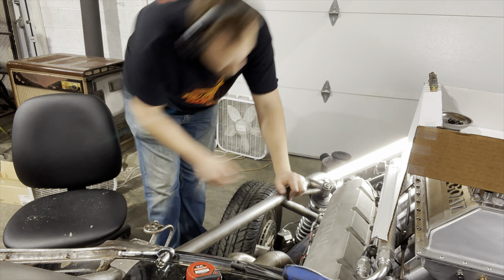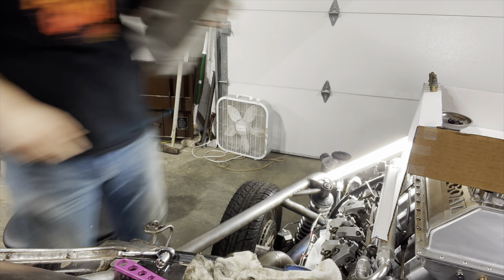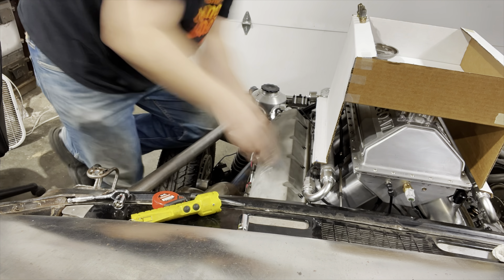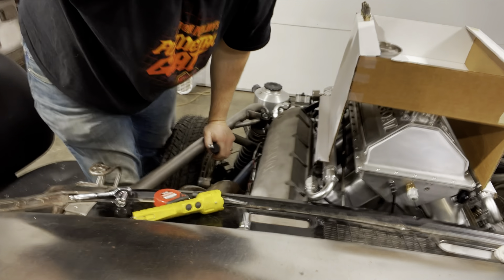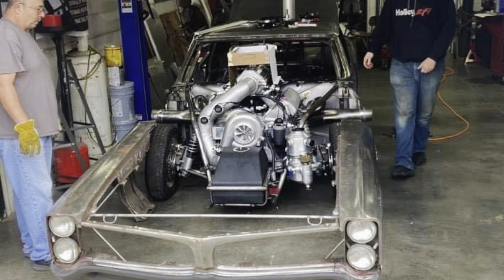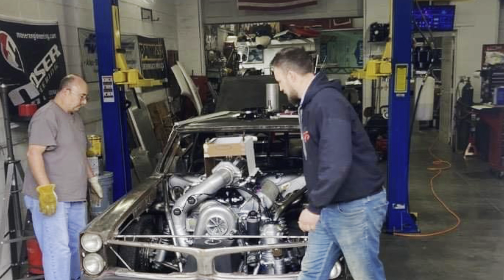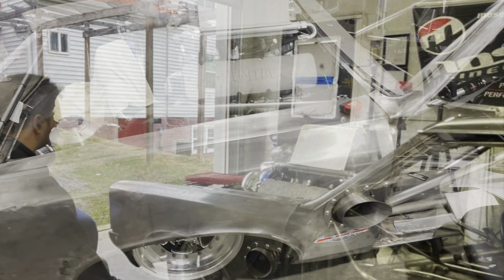It's time to get these old valve covers off and do a little bit of checks inside — also checking the valves to see if the rocker arms have any damage, but everything looked good and was in good shape. I'm just being a little bit over-cautious. Now it's time to move on, get the spark plugs out of it, gap those and get ourselves a new set of plugs in there. Old dad ended up stopping by and helping me get the front end off the wall and back on the car — it's looking pretty wicked with the front end back on.